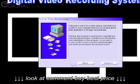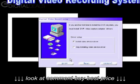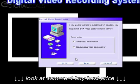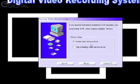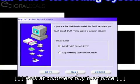A welcome screen comes up, and click Next. And this is where it's asking if you want to install the video device drivers. Since we canceled the installation of drivers via Windows XP, in this stage of the installation process, we do want to install video device drivers. So make sure that Install Video Device Drivers is selected. It's usually selected by default. So you're just going to click Next.